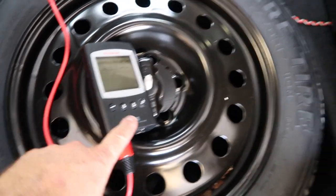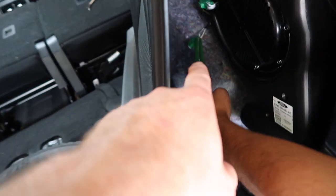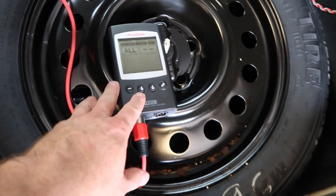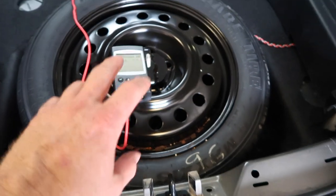And it seems like every one of these Fords we're doing, we're just testing now for fake noise because we don't know which ones they're putting it in. Some F-150s have it, some don't. I'm just not taking a chance, so we hook up an RTA to every one of the outputs and see if it has noise. We rev up the engine, we close all the doors, and as long as this thing doesn't move, we know it doesn't have fake noise, we don't worry about it.